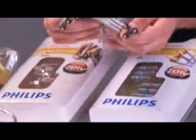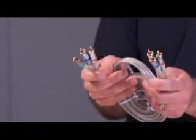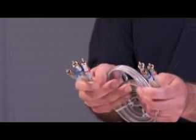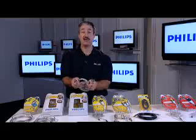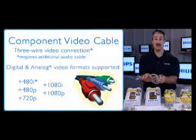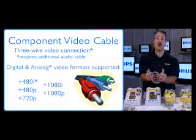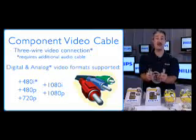The last cable in the digital video connections is called component video — more of a crossover cable. Notice the colors: red, green, and blue. These are made for easy connection to your display device and your set top box. On the back of a progressive scan DVD player, cable box, satellite receiver, or gaming system, you'll find red, green, and blue outputs. Simply match them up on the set top box, match them up on the television, turn them on and you get a great picture. This supports 480p, 720p, 1080i, and up to 1080p — but no audio. It's a crossover cable because this same component video connector also supports analog component video at 480i, making it the start of our analog video connections as well.